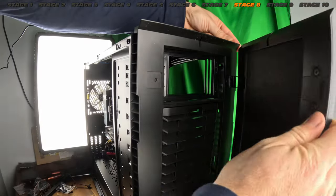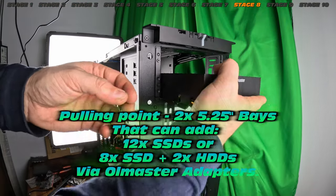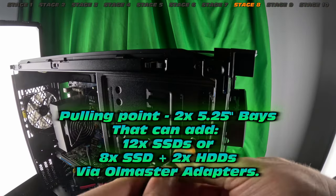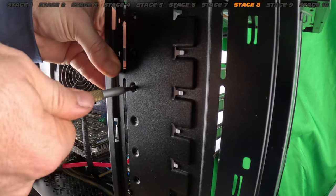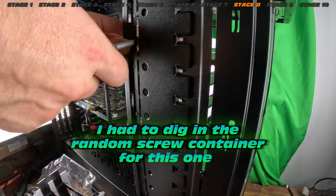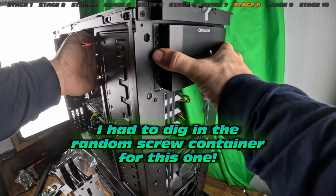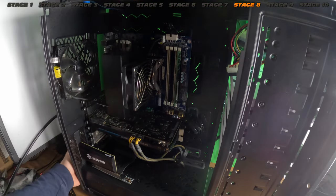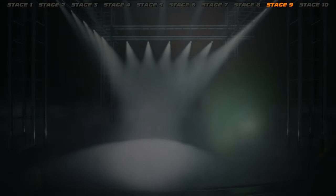What if you wanted to run even more hard drives? I love these Old Master adapters, so I'm going to chuck in a couple of them — why not? That allows fitment of a lot of drives: 12 SSDs between two adapters, or two hard drives and a total of eight SSDs — pretty cool. Very important with these screws: make sure you get a nice fit with that white tab, otherwise your hard drives may not be fully secure. The Old Master adapter was relatively easy to fit.